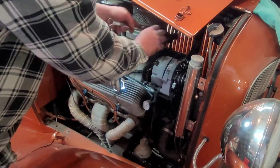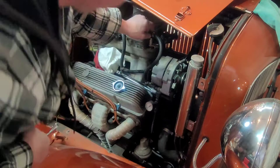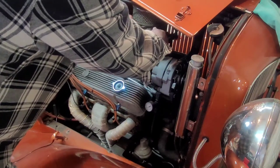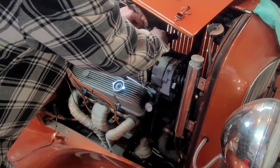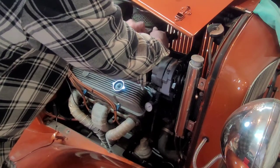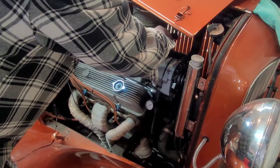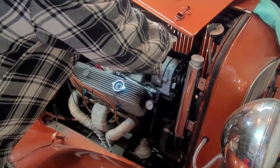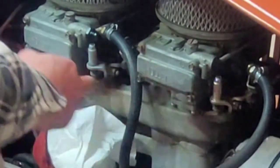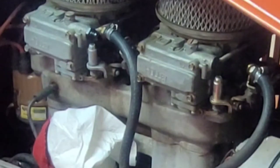These carbs - I got them out of the box from Summit Racing or Jegs many years ago. Slapped them on. Mechanical secondary, single feed, single pump carbs, no chokes. There just was not enough pump shot to wet down the walls of that tunnel ram, and it would always nose over and get a real nasty lean sneeze. After putting a couple miles on it and almost getting plowed into at an intersection, I wanted to upgrade the accelerator pumps to 50cc pumps as you can see here. A couple jet changes later and it's actually surprisingly good on gas mileage and runs rather well.